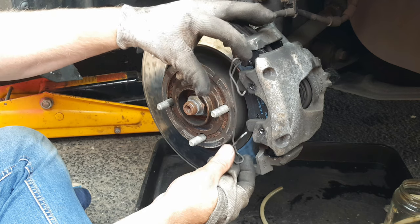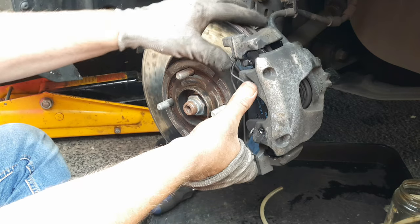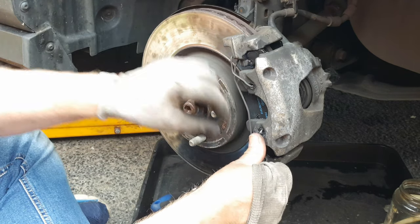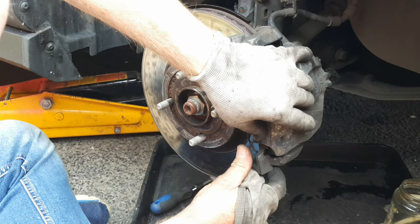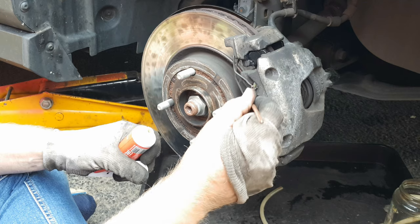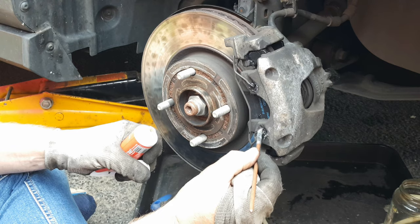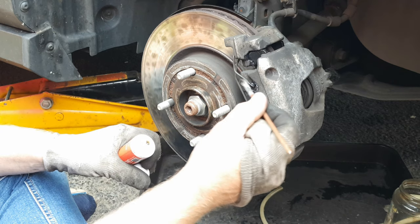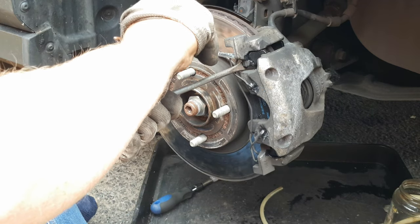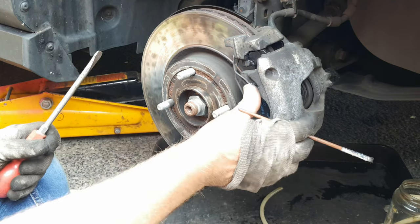Now we need to put the clip back on. I start at the top, put the spring into the top clip and bring the spring round to the inner side of the carrier. Make sure that's pushed in, then push in the spring lower leg and pull the lower portion to the back on the inner side of the carrier. I also put some more Ceratec around here in an effort to keep that sacrificial corrosion at bay and stop water getting into the hole. It's also worth putting a little Ceratec where the spring contacts the carrier just to make sure that it all moves freely.